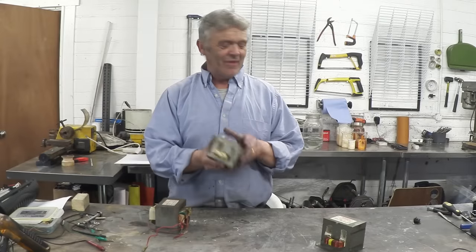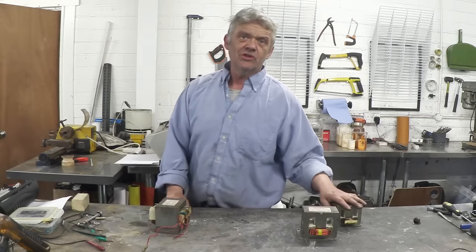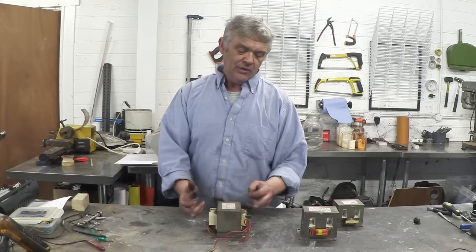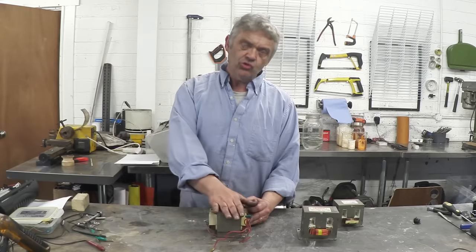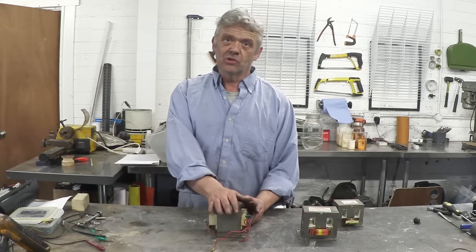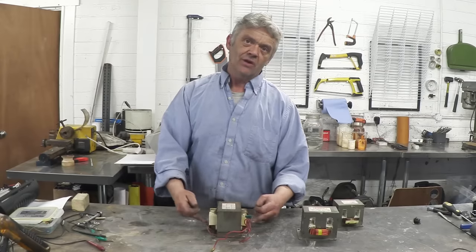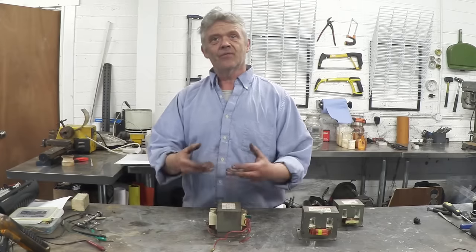Okay, here it is all cleaned up. That was so easy I did a big one too — there's a really big one as well. Now the way to use these things is all to do with the ratio of turns in the coil. This lower coil with thick wire and not so much of it is the primary; the upper one with thin wire and absolutely tons of it is the secondary. This one steps the voltage up because it's got to run a magnetron that needs about 2 kilovolts. The supply is from the UK at 230 volts, and it needs to step it up about 10 times — so there are 10 times more turns in the secondary. If the primary has 200 turns, the secondary will have 2,000 turns to get that voltage step up.